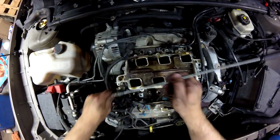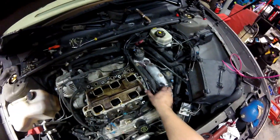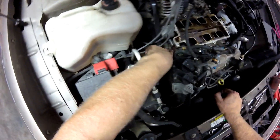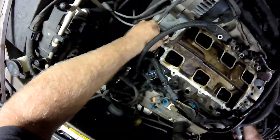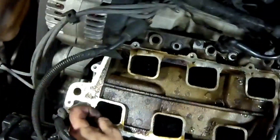I'm going to grab all these bolts. Once I lift up the intake, I'm going to lift it up from this side, because over here we still have this elbow. I'm just going to slide the intake out of the elbow and hopefully not have to get a new one. If you do, they're like 10 bucks — they're not very expensive. Just give it a tug. Can you see the elbow that I took it out there?